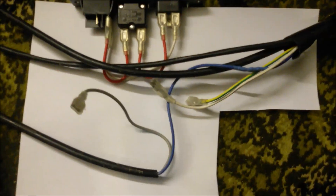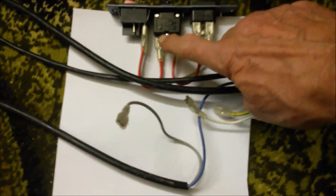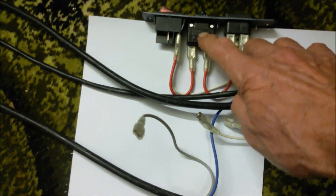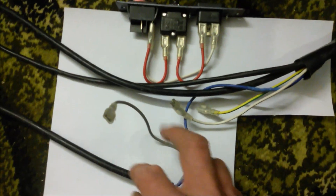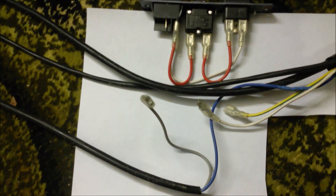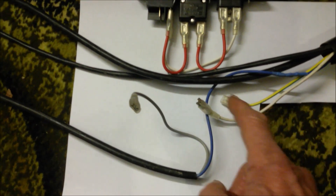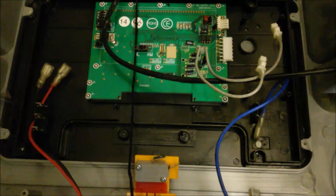Before I forget, I'm going to just record the layout. So that's the power input with some cutoff device. The socket comes in here — live and neutral. Live goes through something which is like a resettable circuit breaker through a switch which switches them both off. And then — I can't remember which way these went — but let's assume this is the live going up to the control panel at the head, and the white wire is the neutral going down to the base. And there's your earth connection.